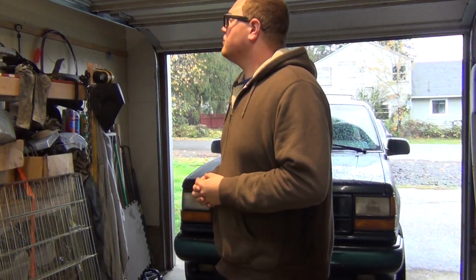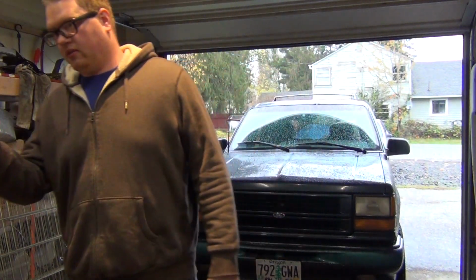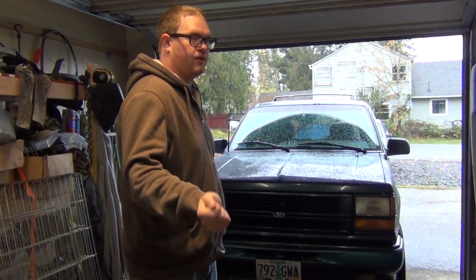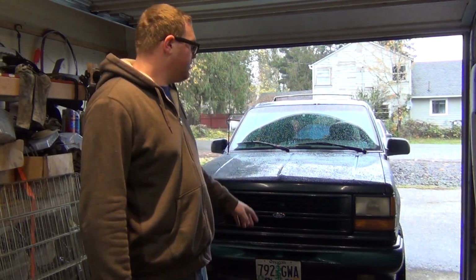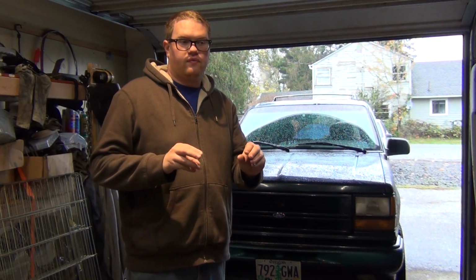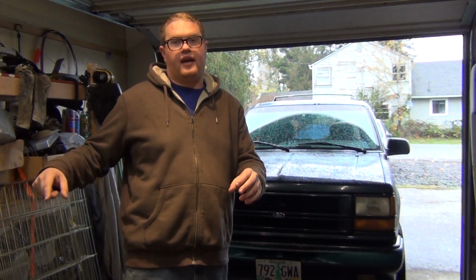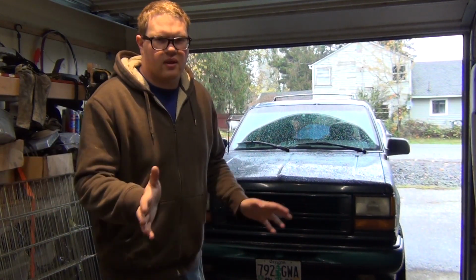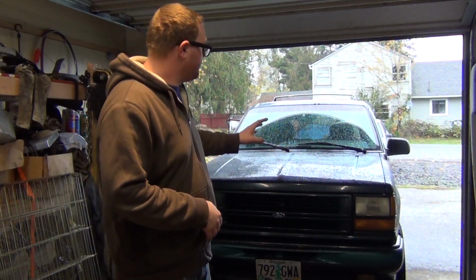go from there. My wiring box usually is up there, but it's around the corner. I think the only thing I might need to go to the store for is a relay, because I'm going to do this differently than how I did it on my truck, because I had that just wired like hot power going right through the cab. I'm going to run skinny wires for my switch that'll go to the relay, and then the relay will feed the light bar directly to the battery. It'll be directly connected to the battery, thicker wires going to the light bar, and then that way we're not having any hot power going through the cab, or high amp power, let's just put it that way.